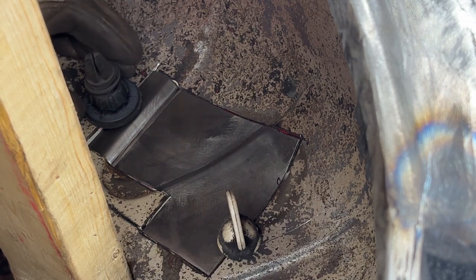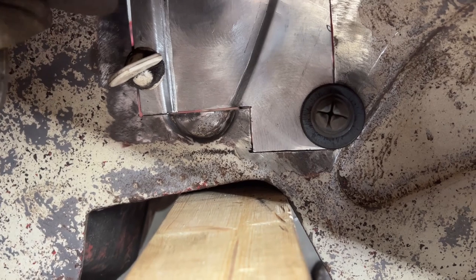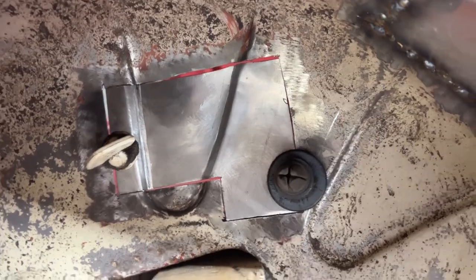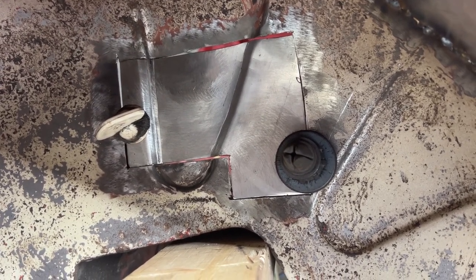Let's see how this is gonna fit now — actually, it looks really good. So what I'm gonna do is clean the paint from around here and inside as much as I can, then start welding it and pushing it up and down to line it up. I think we're ready to start welding — it's not perfect, but it looks good enough for what it is, deep inside the wheel well. I don't think there's gonna be enough room for the camera and me to work together here, so I'm gonna start on my own and give you updates every once in a while.